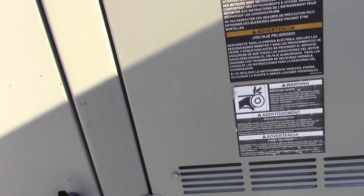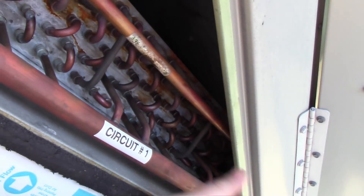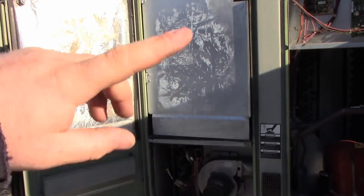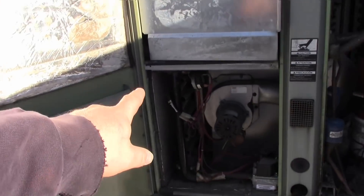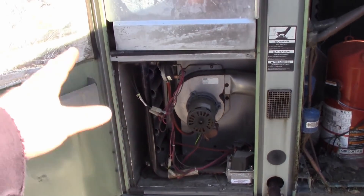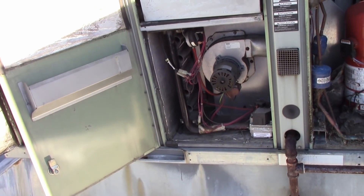The burner rack and everything needs to come out. Inside here, once I get this off, there's a row of screws and usually one underneath the drain pan, so we may have to slide the drain pan out. I already have the gas off and the gas line union already broken. I'm going to cut these zip ties, take a quick picture so I know where all the wires go. You always have a schematic but I like taking a quick picture so you don't screw it up.